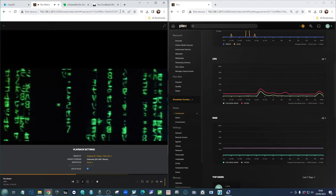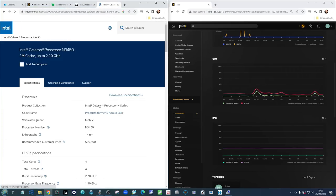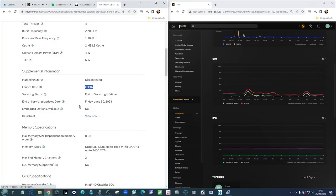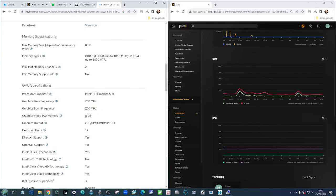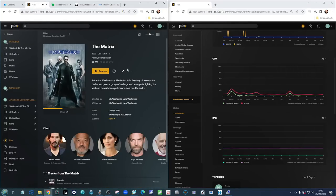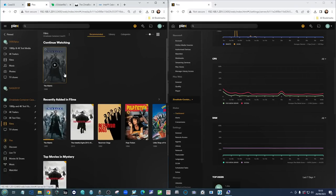The reason for concern is the CPU has integrated graphics but it's not the newest. Looking up the N3450, you can see it rolled out in 2016 and has since seen an end-of-service update. For this price point it makes sense, but the integrated graphics are limited. When it comes to conversions and transcoding, that's when the integrated graphics will be required and tested.